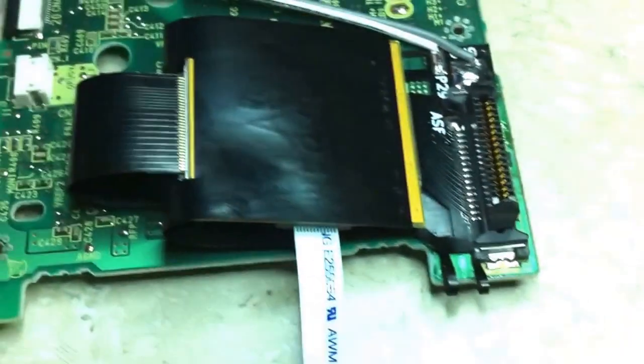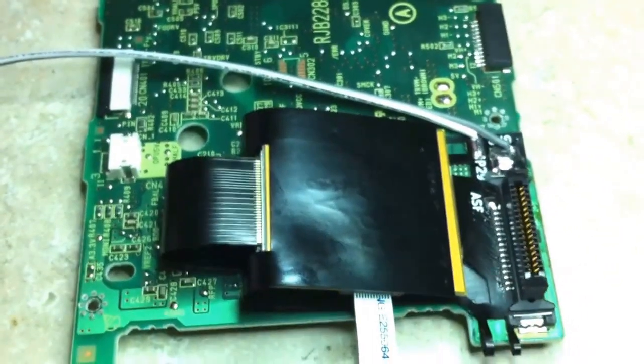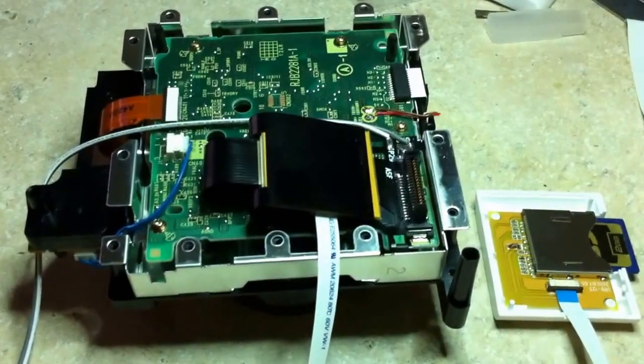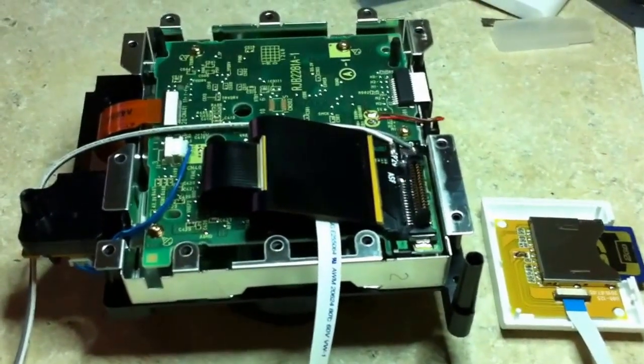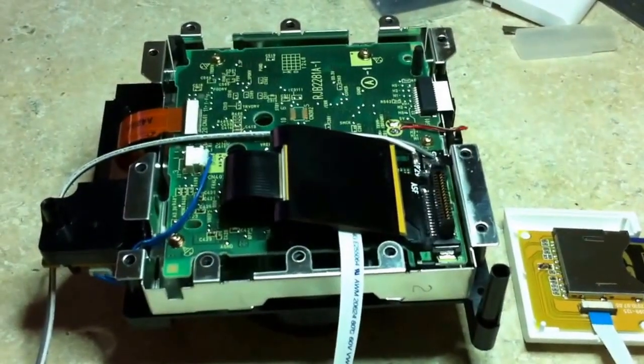That's my current progress along with the Pin 29 and ground wires connected for my Switch. Next thing to do is put this board back onto the DVD drive and test it. Drive is put back on. Next thing to do is just put the metal cage shell and then pop it in the GameCube and test it from there.